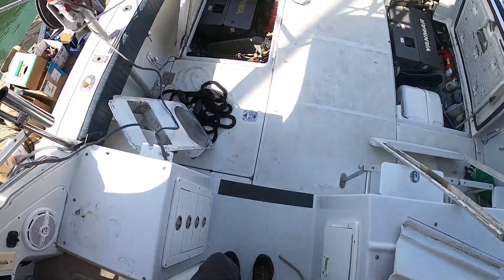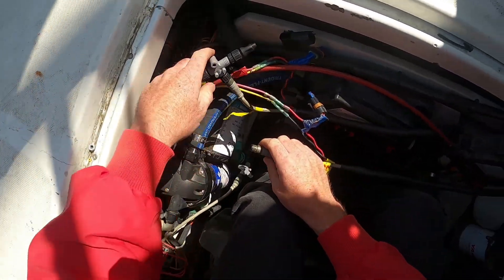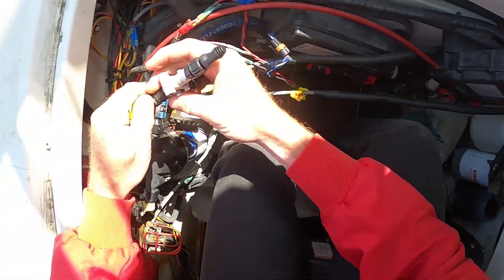I got both to shift. So our fuses are kind of junk and that's what's causing us to not shift. I reinserted the fuses and everything is working a-okay — I heard both engines shift, so let's verify again.